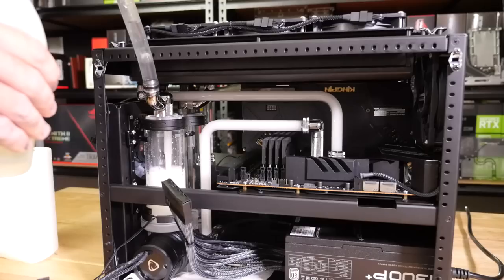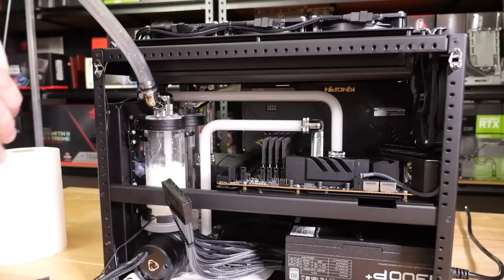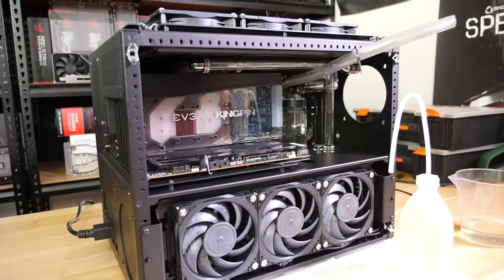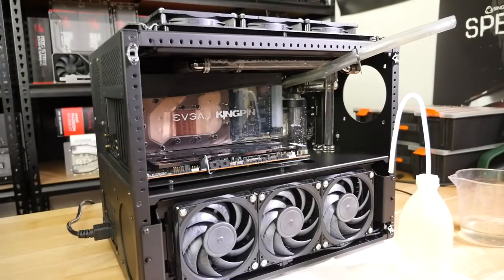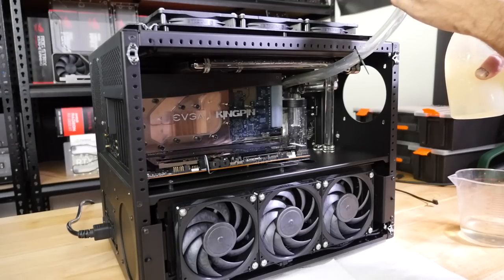And they're the ones that I really want to use the most, because what you're trying to do is build the shortest loop that you can, picking the component order that gives you the shortest overall tube length. So going the shortest distance. You start at one port, what's the nearest thing that you can connect to? And you do end up with some really short lengths with offsets, where it's hard to find the fittings that you need to make the connections. But that's where you need a good range of fittings, extensions, rotaries, all the rest of it, D plugs.